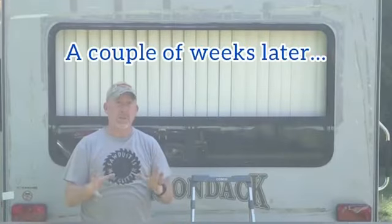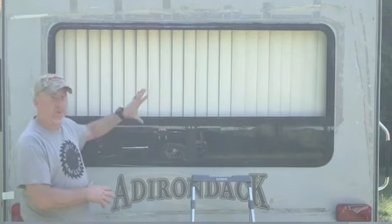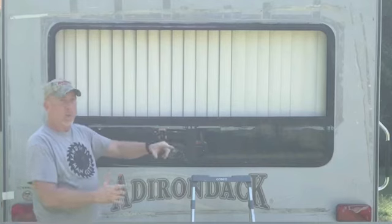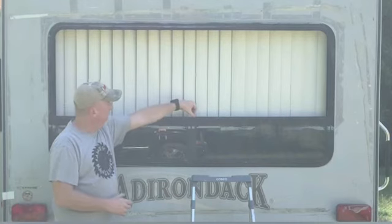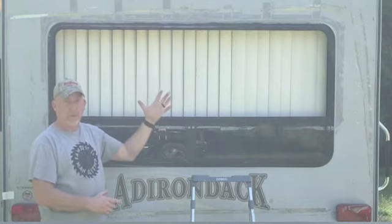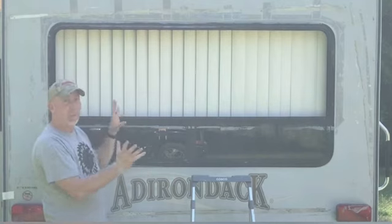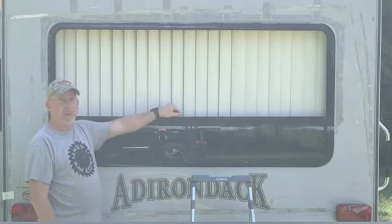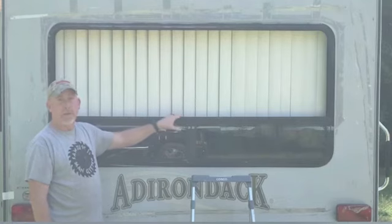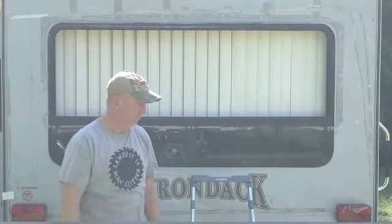Okay, so first things first, we're going to unpack the glass. Then we're going to check it for fit here in the hole. We'll take it back out. Then we'll take our sealant and lay a bead of silicone here along the lip all the way around. That provides the airtight seal for the glass in the window. We put the glass back in and replace the trim that's here, which helps secure it and hold it in place, and it makes it look nice. So here we go.